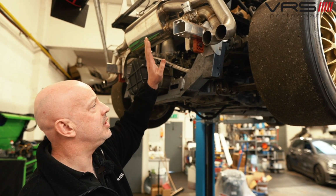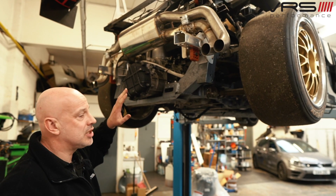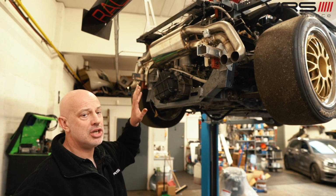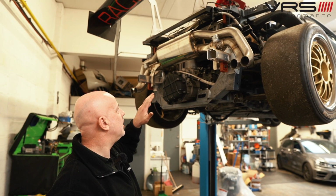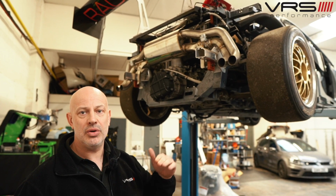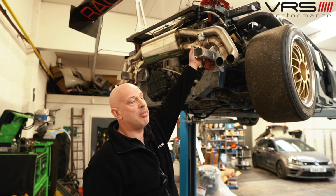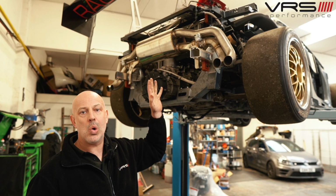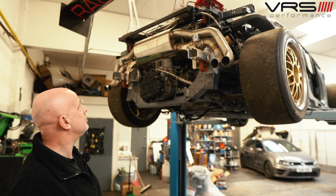And we've replaced the exhaust system, because the exhaust on this car would have had a really loud exhaust, because there would have been different rules back then, but this is going to be used for different things now. So Racing Line are going to use it for hill climbs and things like that, where there's obviously a noise limit. So this has got a valve operated system here, so we'll put an electronic valve on that so it can have loud or quiet, if there's a noise restriction.